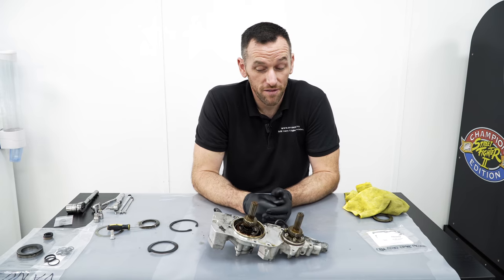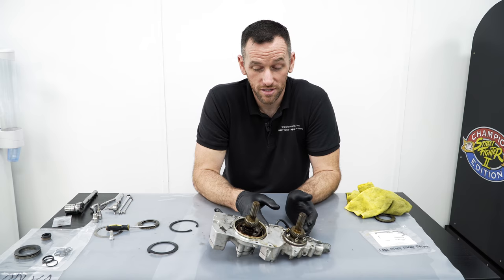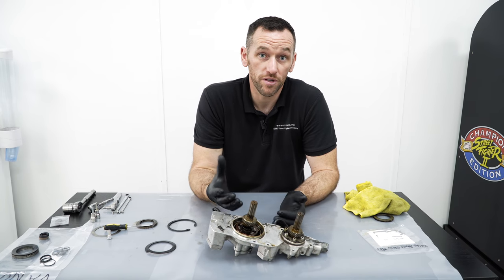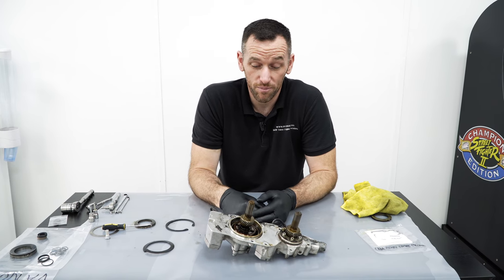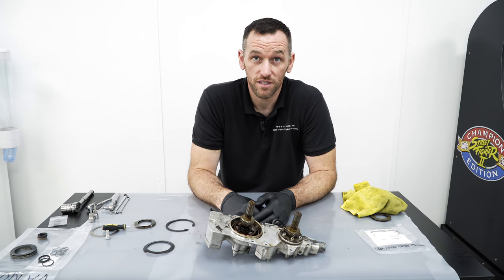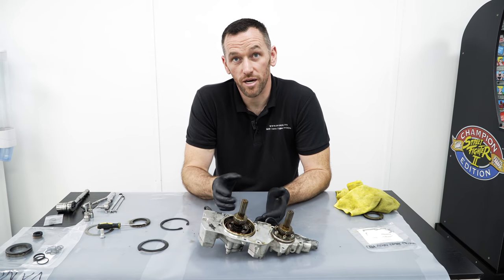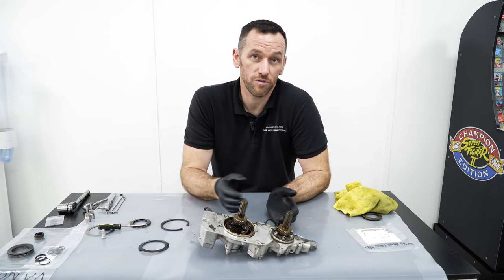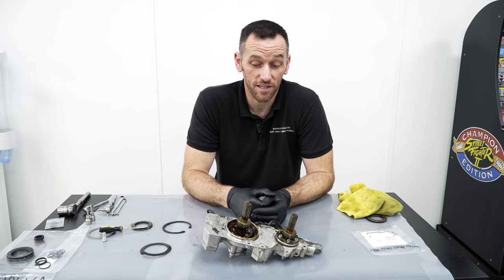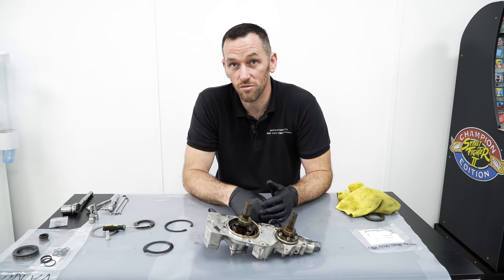The V10 M5, I would say, probably is the last car that had a VANOS unit and a separate oil feed, but they had an oil pump in the sump. Again, problematic because of 115, 120 bar, needle bearings failure. And that's the kind of last BMW engine that ran external pipe work and an external pump separate from the engine oil pressure. And yeah, that's really the last car that has any sort of issues, funny enough. Everything after that is generally much more reliable.